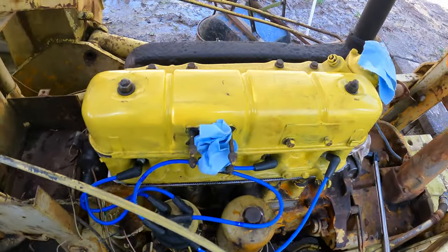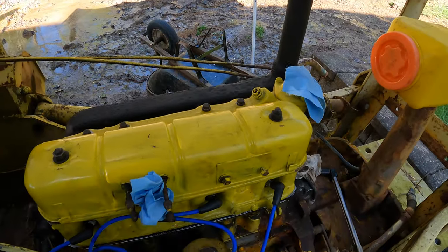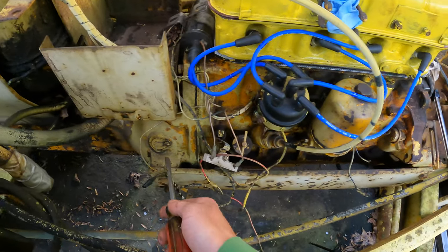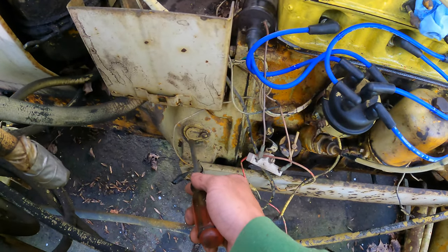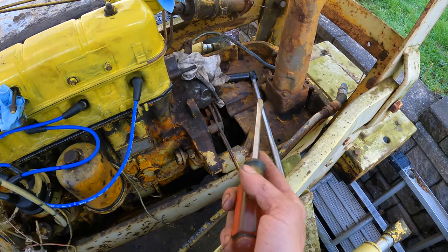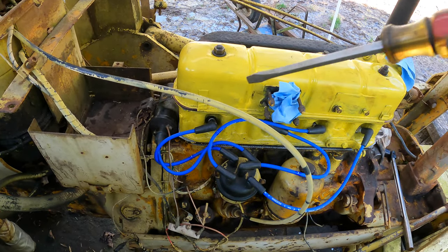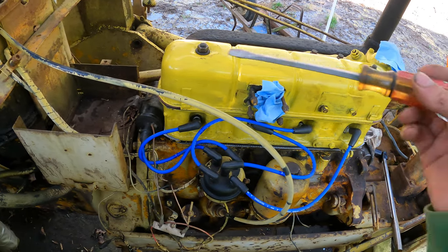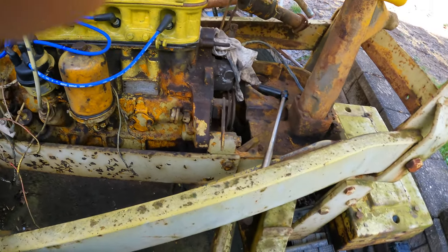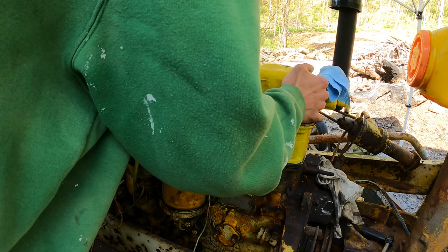While we're here, if you didn't see the progress last night, so water jacket, exhaust manifold, and I just threw this coil pack on. But what we can do now is open up this inspection cover and read on the flywheel as we turn over with the 13/16 to get, we'll put a screwdriver in there, get TDC, pull this valve cover off, and then we'll set all our valves. It shouldn't be that bad. I just couldn't do it last night because my brain was fried.